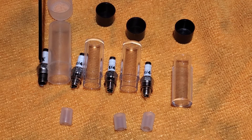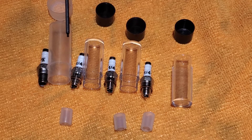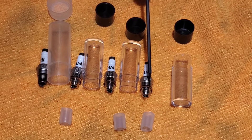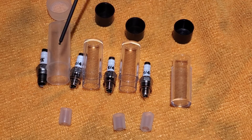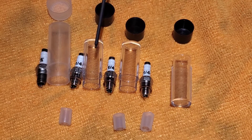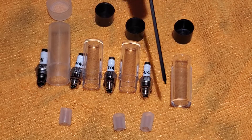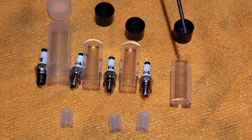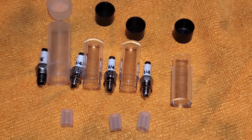The PK plug on the end is the one from China that comes in the engines — you can order spares from Sterling Kit or wherever you got your engines. These three plugs were all packaged identically with a smaller clear vial. The PK comes in a big cloudy plastic vial, but the next three come in clear vials with a black cap, and they each have a piece of rubber hose to protect the electrode end during shipping.